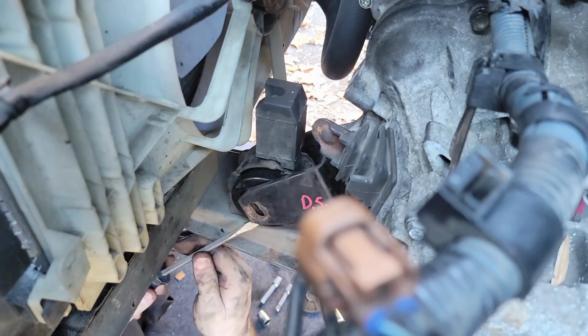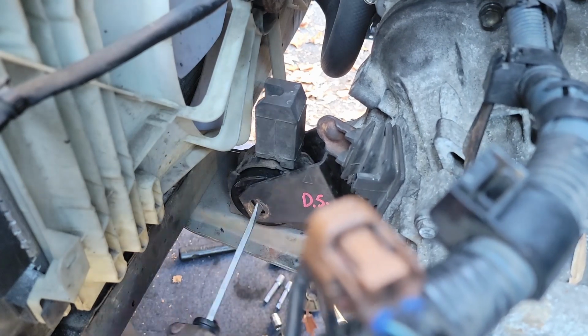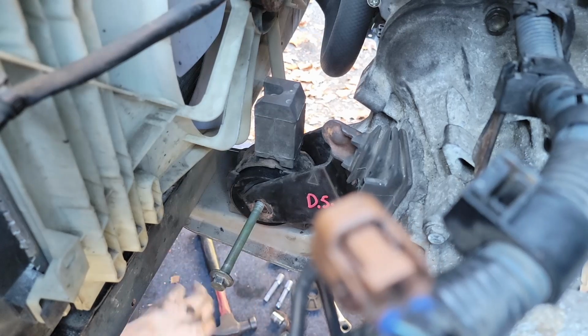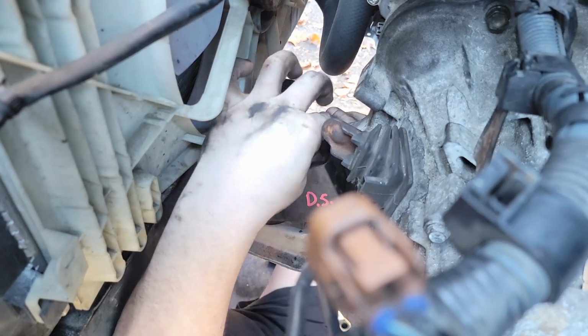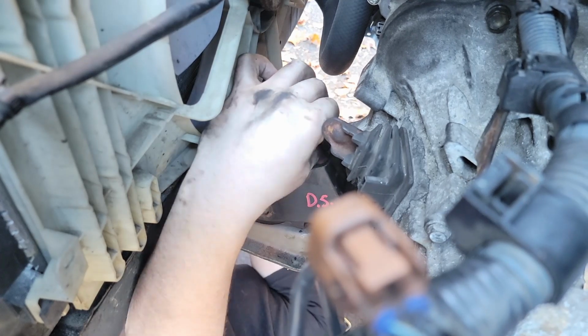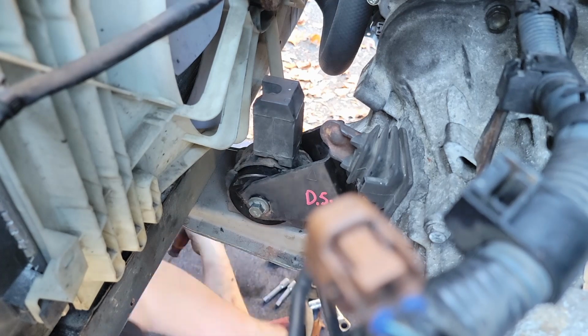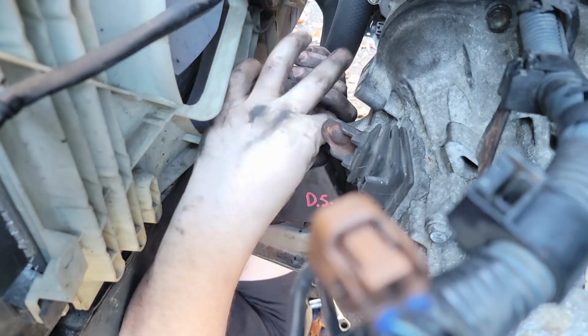Before we remove that jack stand from the engine oil pan, we want to make sure you do the mount bolt hole through the middle here. That will really make sure that we're fully supported since we already have the bottom bolt installed, and then we'll have the center bolt through there. This also makes lining up the top bolt even easier. And right about here, I was like, wait a second, I think this jack stand is stopping me from getting this angle. So I quickly hammer off a piece of the wood and it's no longer being balanced on there.